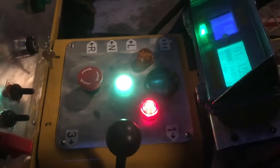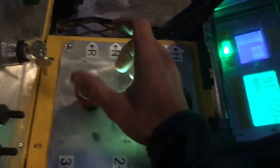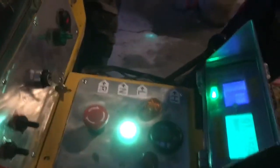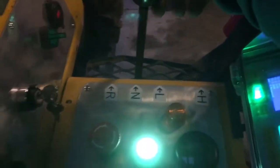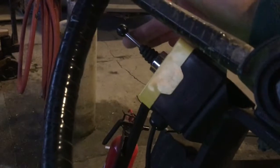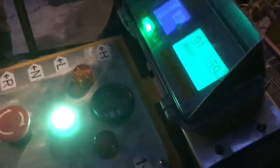That's the battery display dash, and then dash two — as I call it — shows that I've turned the key switch on. If I reset emergency off, now it's no longer an emergency off. If I shift it into neutral, then it'll be able to spin the motor without running me over. I'm now choosing a direction with the forward-reverse direction switch. Now I should be able to spin the motor up, and we'll hear it. We can also see it on the tach.